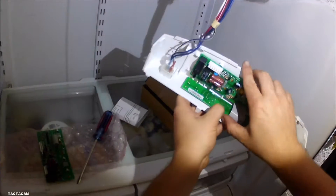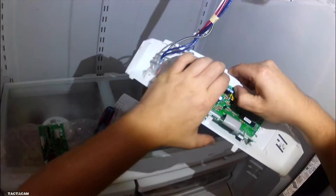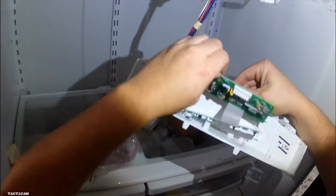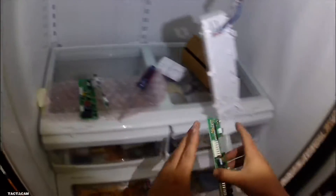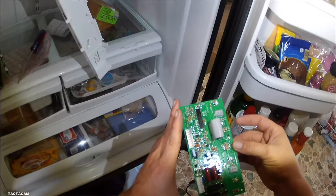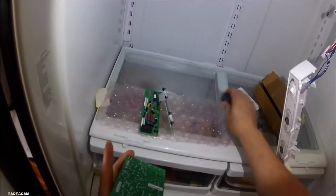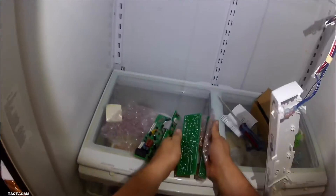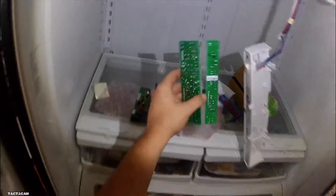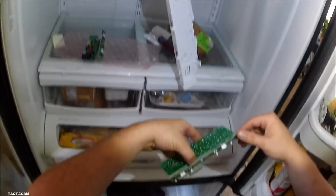So you've got those harnesses, and you've got some clips just holding this in — no screws. And yeah, you just get that old board out. This new board — you see how it's not broke apart like the other one is? So we've got to break this thing apart. I'm just going to let you guys watch how I do this, and then we're going to put the board in. And after we get it in, we're going to program it.